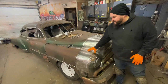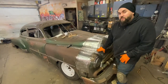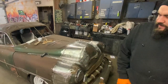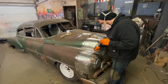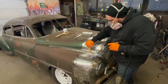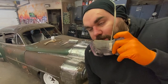I'm only doing lead work on the top of these fenders and this section of the hood. The reason I'm doing it there is because that's where I want structure, and I've also done a million little cuts there. I don't love the metal work, so the lead will clean it up a little bit. But really, you could do all this with bondo. I just like doing lead because I know how, essentially. We'll probably throw some bondo on it after that. This takes forever, so let's time lapse.